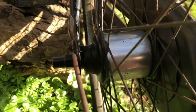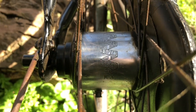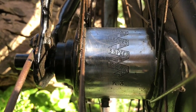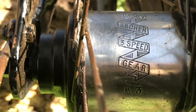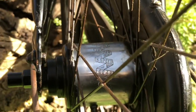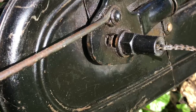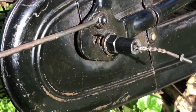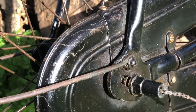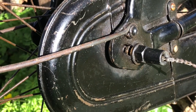I'm going to shortcut and go straight to the rear hub. Let's turn it around — you see it's got an oiler on. I'll spin it around so you can see the lettering. There's the money shot: Sturmey Archer three speed. And below we have the stamp K3, which indicates 1933. This does have a through-and-through indicator rod, like the F series of four-speeds — I'm glad it's got the indicator rod in it. I did another bike, a Humber, with a K series hub like this and it didn't have one — nightmare that bike was.